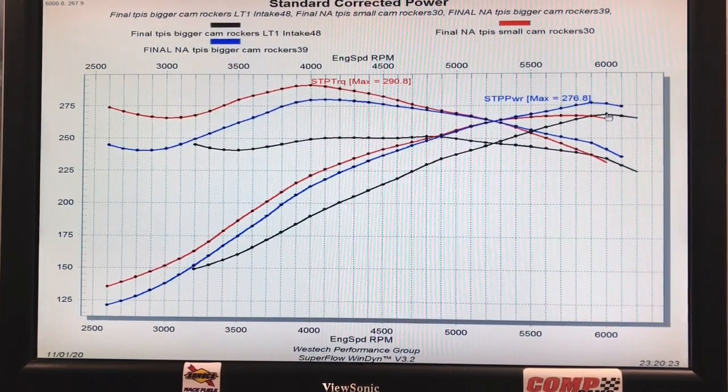I spent a lot of time tuning this combination. I tried timing sweeps of 12 degrees — 6 degrees in either direction from my starting point — and went all the way up as high as 32 or 33 degrees. It just didn't make any power past 30 degrees of total timing. I tried air-fuel ranging from 13.3 all the way down to 11.3 and found it was actually liking the low 12s. As we leaned it out, it just didn't make any power, and it wasn't really receptive to air-fuel changes anyway. Even after richening it up and changing timing, past 30 degrees it showed no preference regardless of air-fuel ratio.